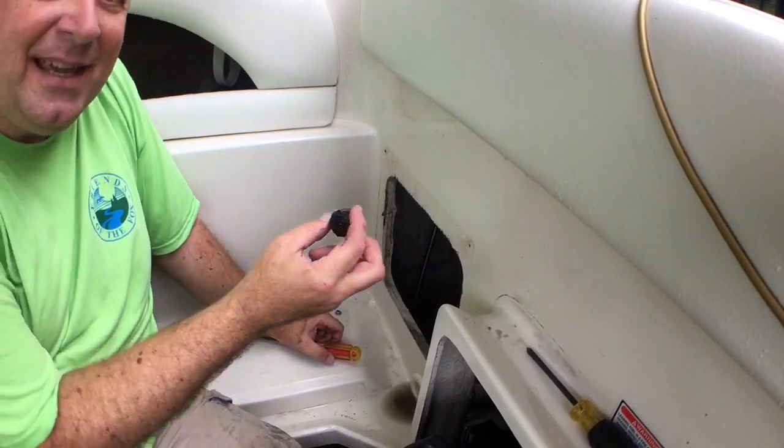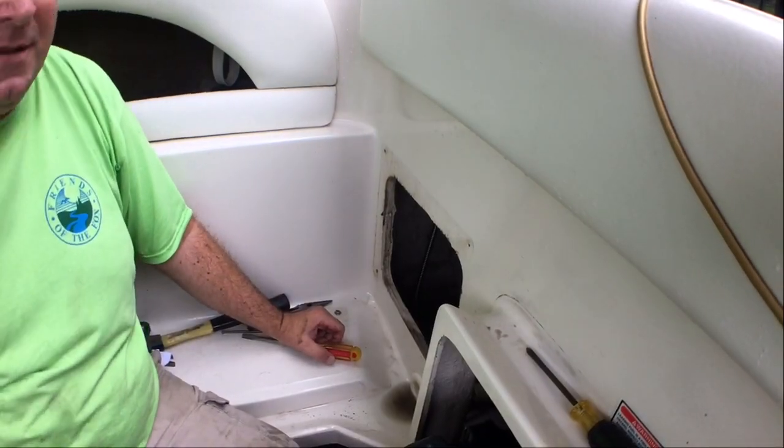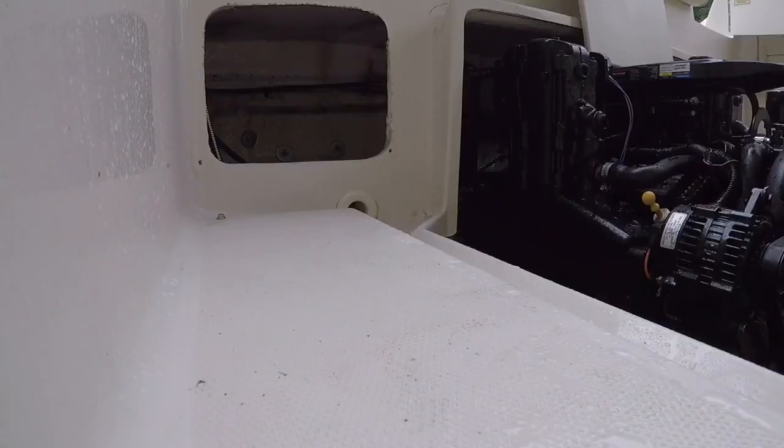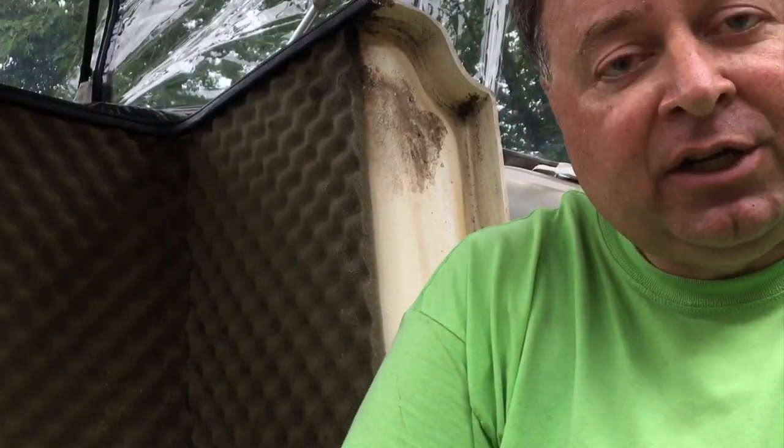Looks like a nut — well, that's gone. All that's left is giving this drain a test. The next thing I'm going to check is something called the float switch. The float switch attaches to the bilge pump, so if you are taking on water it'll automatically turn the pump on to try to keep you from sinking — so it's pretty important. By the way, this is my third Sea Ray, and the first two, as I bought them and did this initial shakedown, both of them were not working. Let's see how this one does.